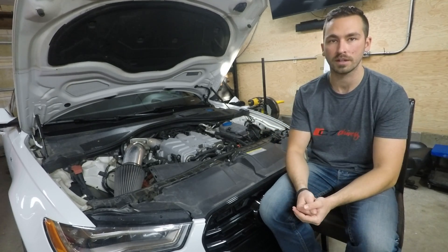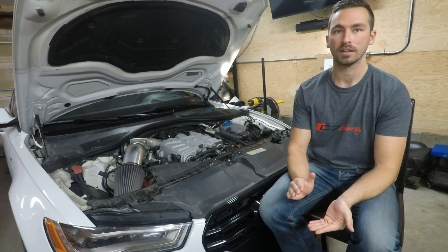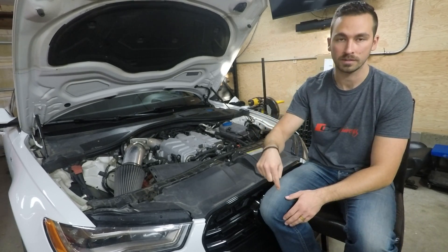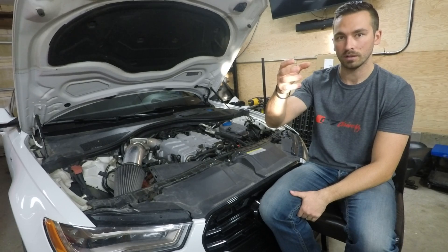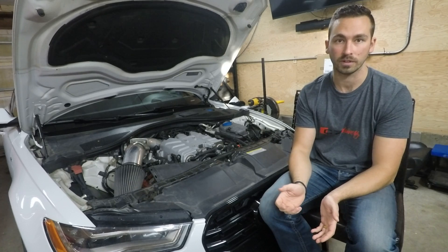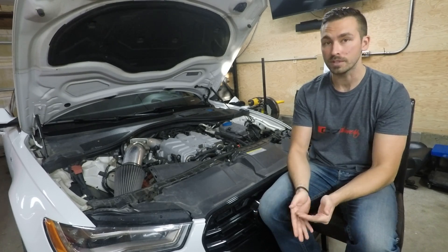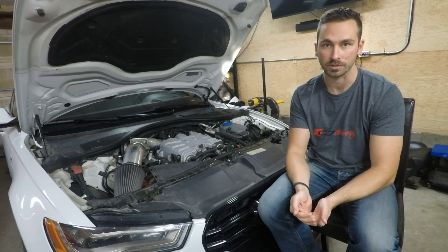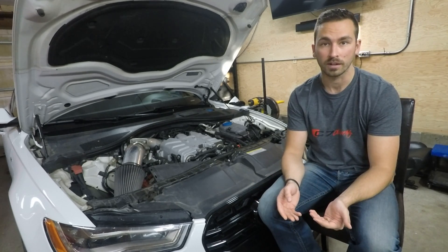If you're considering or already have a divorced system, take a critical look at it. A good question to ask is where the loop is flowing through. If it flows up into the reservoir and then back down into the pump, instead of just having a bottom feed on the reservoir — which is basically the same as OEM gravity-filling if there's coolant loss — if it flows into that reservoir, I would pass on it. That's how foaming happens. Foaming adds more oxygen into the coolant solution and reduces the effectiveness of the entire divorced loop — more air in the water is a problem.